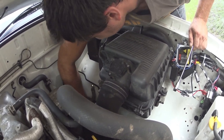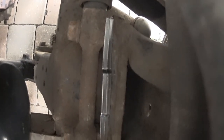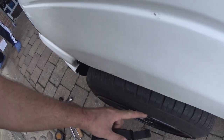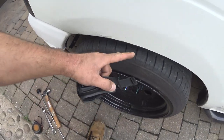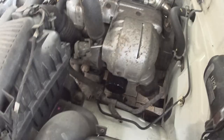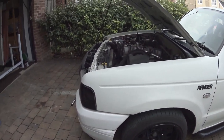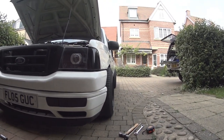Squeeze that in. So they're both in there now - we've got 8mm this side and that's pulled the top of the wheel in to 39mm, so we've got a 12mm difference at the top of the rim and that's a 17-inch rim. So we'll see if it scrapes. The camber looks really a lot better - it's coming in a lot. Mini trucking style.